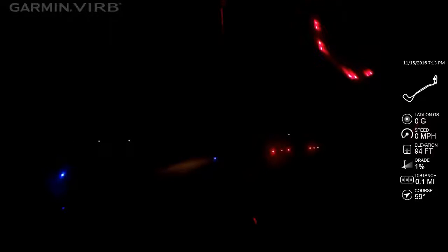Alright, so time for the run up. Brakes are on, seats and belts, doors and windows are locked. Flight controls: we are up on that side, down on this one, up on that one, down, and we have full elevator travel. Fuel quantity I've checked, we've got 25 gallons, the gauges are both reading. Fuel selector is on both. Mixture's going to rich. Throttle is going to 1600 RPM.